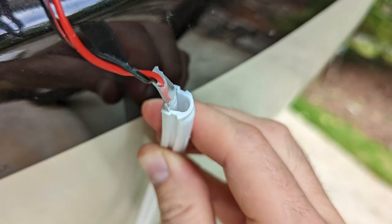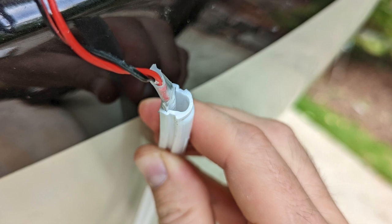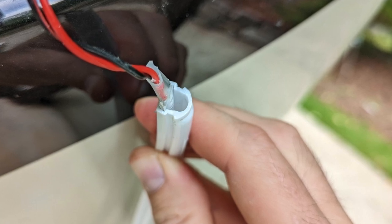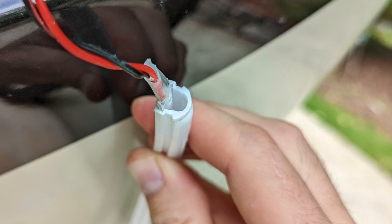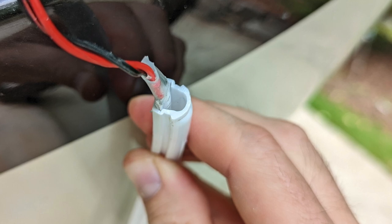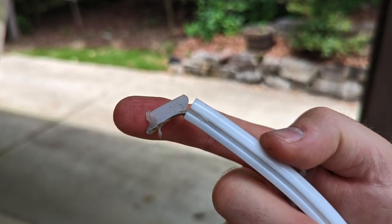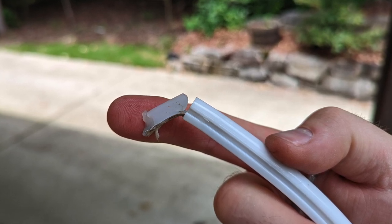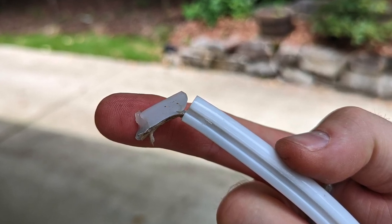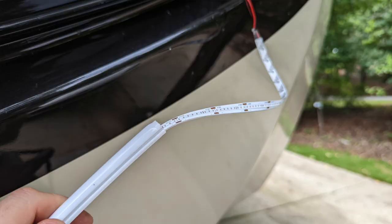You can see in the picture what it looks like at the end of the tube where the LED strip starts with the wires — and you can see where I completely forgot to seal up one end. This is probably what it looks like from the factory unless they've started sealing them. That's where water intrusion occurs and eventually leads to failure of the strip inside. The next picture shows the opposite side — the passenger side — where you can see how it should be properly sealed, with silicone fully conforming to the inside of the vinyl tube.